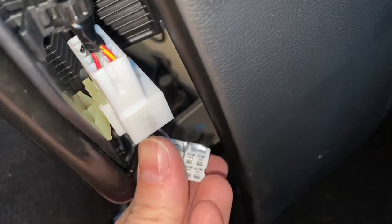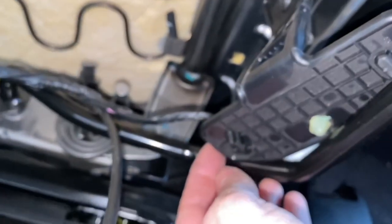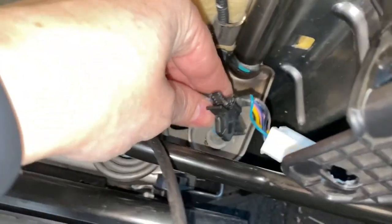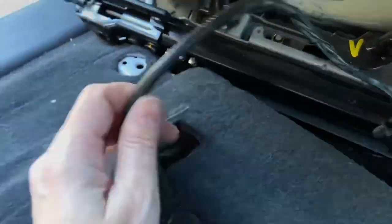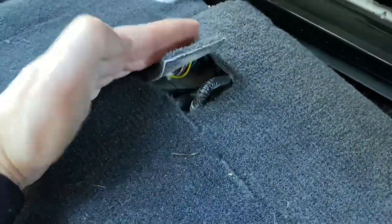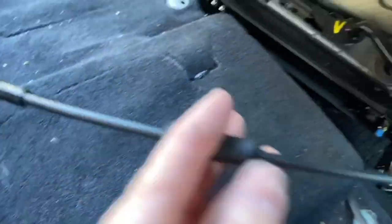The seat is still attached to wires, so don't just pull the seat out — you think it's loose but the wire is still attached, so you have to get under there and undo the wire. Pull apart the plastic pieces — I pulled them apart by pushing this little button on the plastic piece. And then around the other side you'll see that it's still attached to the vehicle with this little black piece; you've got to squeeze it and poke it through. With the part still attached to the vehicle I shoved it underneath the carpet, and the other piece for the seat heater I just tucked underneath the seat.